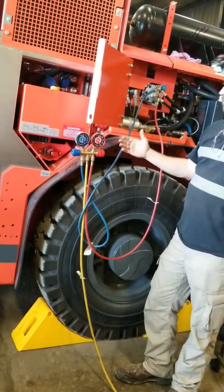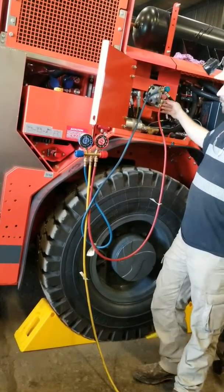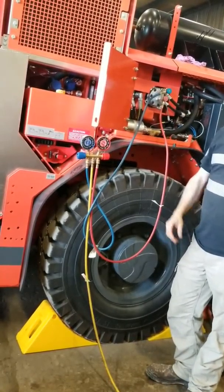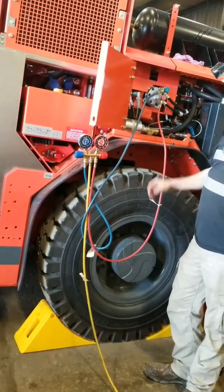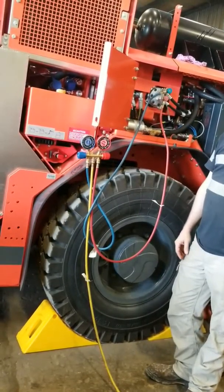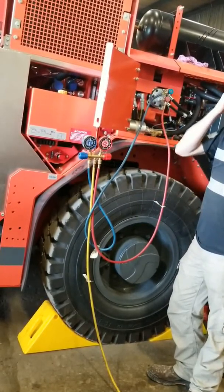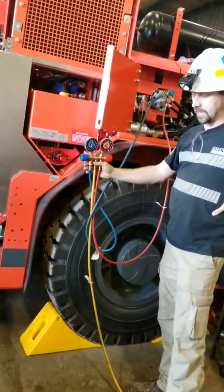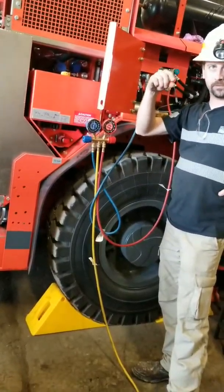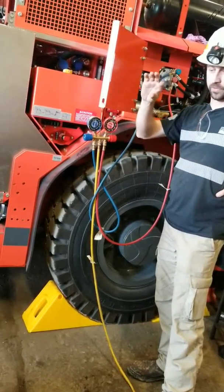My rule of thumb is this: if you change the compressor, you need to make sure it's got PAG oil. There's a small hole in the side — you take it out, fill that with PAG oil, put that plug in. If you're charging a system that's been running, don't add a drop of oil. Don't add any. Dye is the same way — that's UV dye we use for leak testing. Three, four drops. That's it. You'll see that. Just three or four drops. Don't pour it in.